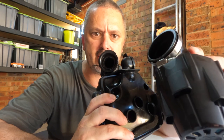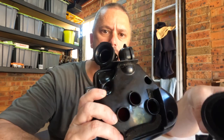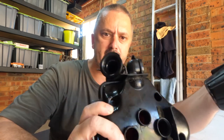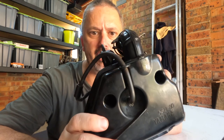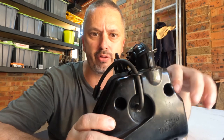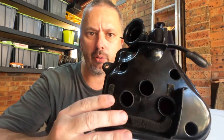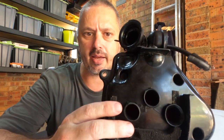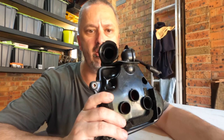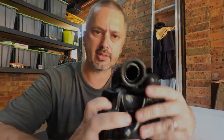Probably still not as comparable as what you would get from this, but a massive improvement. So here is where the test kind of begins. We know with a stock Airbox, we can only rev to 3,600, 4,100 with a filter in it. Still nowhere near this, but how will it go with this modification here? And will I get everything that I want from the pod filter into the stock Airbox?